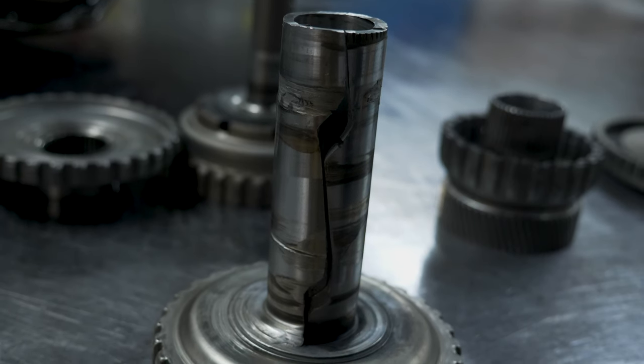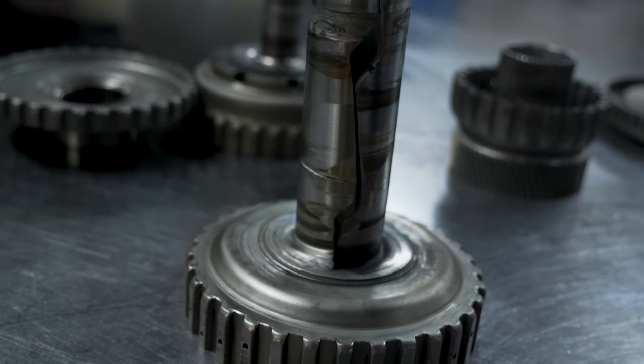Hard part-wise, billet input shafts are available and more parts are slowly becoming available. We don't often see the insides really broken, but occasionally we do see things like an overdrive hub support broken — we had one come in recently that yard-sailed the transmission and broke everything connected to it, causing a lot of damage. That truck had 37s, was a welding rig, towed a fifth-wheel camper heavily, and was seeing a lot of load — not necessarily just a horsepower break, but stress load on the transmission.